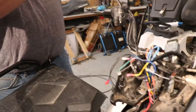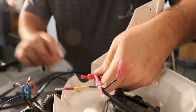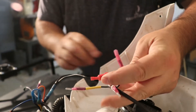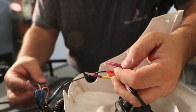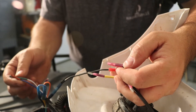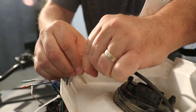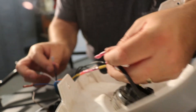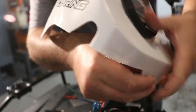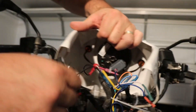Speedometer gauge — console cluster, whatever you want to call it. Start plugging in the wires. One thing I left here is a little ground for one more low voltage thing we're trying to do. These two terminals we actually just capped off of the switch because they're for the high and low beam, which we're just going to use as on and off. One of them will have power coming to another LED. We put the little yellow heat shrink to mark that. We've got the blue coming in right here.